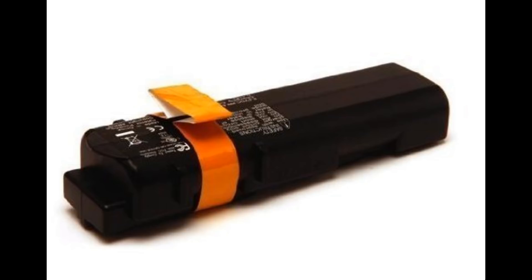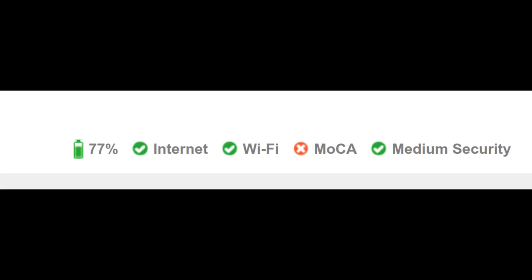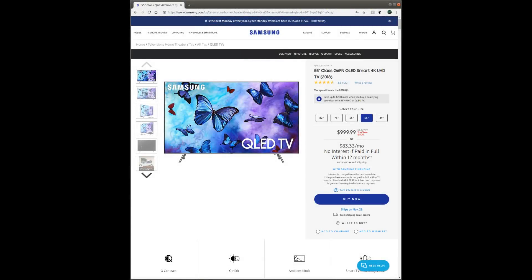Speaking of the battery, this router has a built-in battery calibration feature. When you first put in a battery, it starts its calibration cycle over quite a few days by slowly discharging and charging it a few times to accurately measure its capacity. I also changed the connection from wireless to a wired ethernet connection thinking that the wireless might be flaky. And again it worked for about 20 minutes, then the connection started dropping again. The router's built-in configuration web page also became very sluggish, so something clearly was not right.